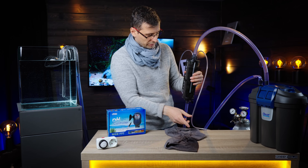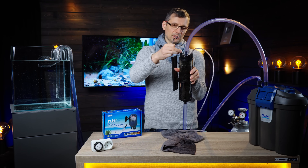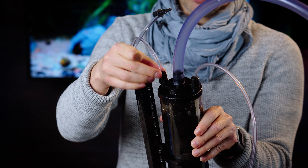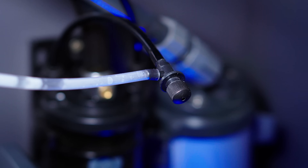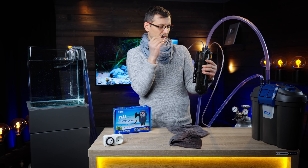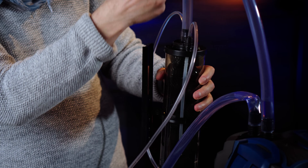You'll also need another hose — ideally longer than what I used here — which connects to the port that does not have the white hose visible, the one that's just a hole with a plug. This serves to get rid of the air that gets into the system when you prime it, so you need to purge the air. You also have a mounting bracket: you mount it against the back wall of the cabinet and push this on so it stays in place near the filter, preventing the hose from bending and breaking.